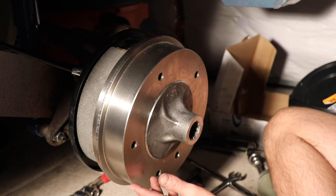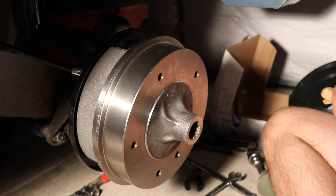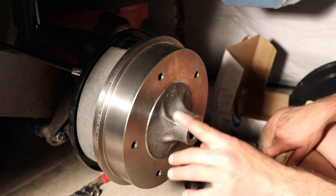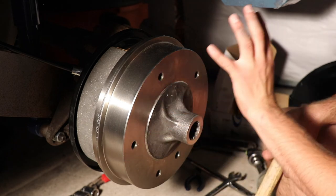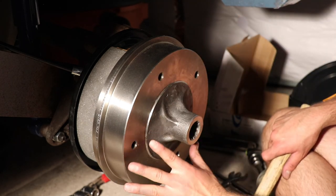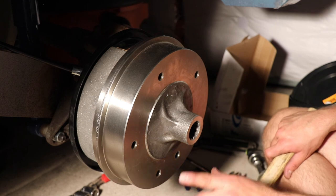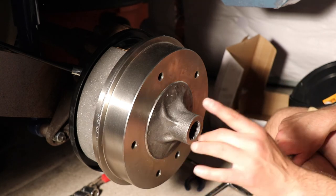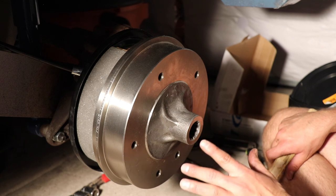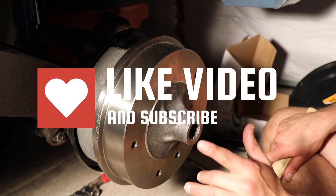That will conclude the video for today. The main bulk of what we did is accomplished — installing the brake assembly. The drum, assuming you're using your old ones, should fly right on with no issue. If you're installing new manufactured drums, they can be a bit of a challenge. Please look for details and defects like an off-center bore. There are a lot of companies cranking out old bus parts because there's money in it. Pay attention when working on these buses. If you have any questions or comments, hit me up below, click the subscribe button, and I'll continue to document restoring my 1965 bus. Thanks for watching.